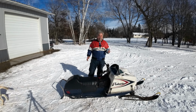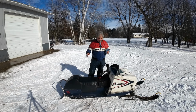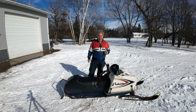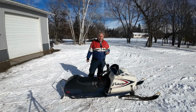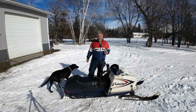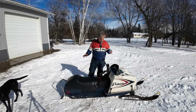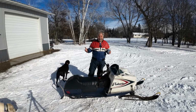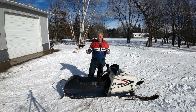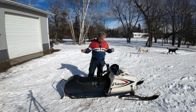But, you know, I'm really happy with this sled. This is really the first time I've driven it in years. In fact, it's definitely the only time I've driven it in years is after I got this motor rebuilt. And, geez, it handles great. It turns great. I've got 8 inches of carbide on the skis. I got a rubber track conversion with studs. I've got a 76TX skid on it, which is the newest skid you're allowed to run according to the class rules. And I've got forged spindles from a TXL. You know, it's pretty well set up. I got the Mikuni carb, I got the Polaris clutch, all legal for the class I'm gonna run it in. So I couldn't be happier with the sled.